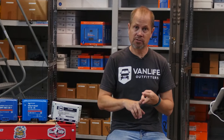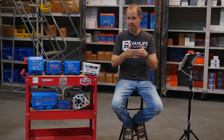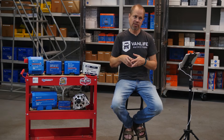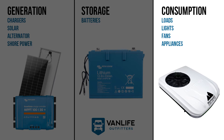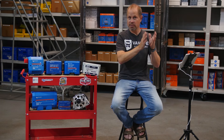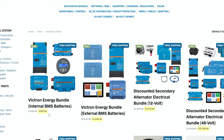So how do you choose between these three architectures — internal BMS, external BMS, secondary alternator? Going back to the three parts of your system — batteries, generation, and consumption — these should all be somewhat in balance. If you're mostly grid-connected to shore power or have modest loads like lights, a refrigerator, and a fan, you probably just need a relatively small battery bank. With smaller storage needs, you can go with basic recharging components like solar or DC-to-DC charging. This paints a scenario where the most affordable internal BMS system is a good choice.